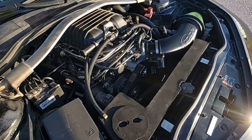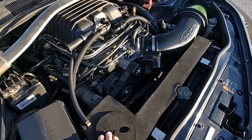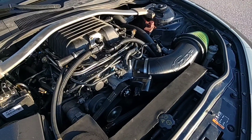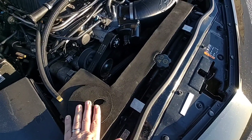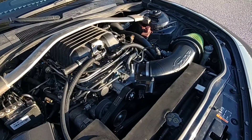If you do quarter mile, it works perfect. You don't have to pack ice around or bring any extra tools, coolers, or anything. You simply make your pull, pull into a parking spot or get in line, let the AC do its job, cool the water back down, and you can make another run. So if you do end up going with a chiller system of any brand, my best advice is: use a one to three gallon tank, make sure you use insulated braided line — otherwise it'll condensate and start dripping water — use the factory ZL1 pump or a Varimax. A high flow pump is not needed for this application. Make sure you insulate all of your AC lines and keep your coolant lines as short as possible. You want to save all the cold water you're making, keep it cold, and not transport it long distances before it gets to the supercharger. If you can accomplish that, you will love your chiller system.